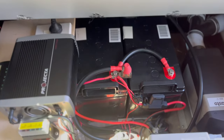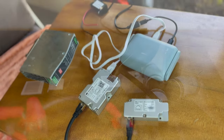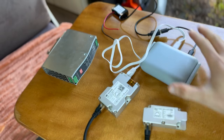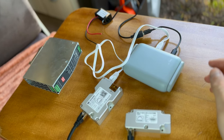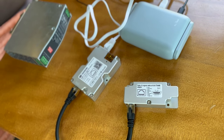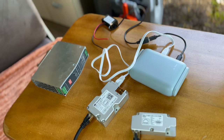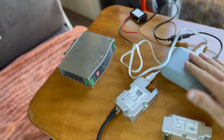To power the Wi-Fi router I've bought a DC to DC converter that converts 12 volts down to 5 volts, which is what the router needs. Just under the seat we've got the batteries — not a lot of space to play with, so I'm thinking of mounting everything to the top of the seat area where there's quite a lot of room above the batteries. This whole kit cost 500 New Zealand dollars, which is about 250 English pounds. There's not too much technical work apart from cutting some wires, and I'm going to put fuses in before the equipment just to be safe.